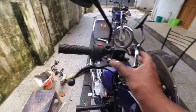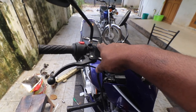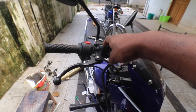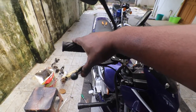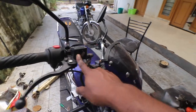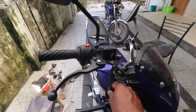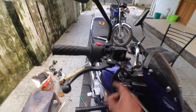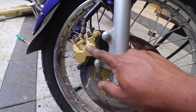This part is called the master cylinder. The job of the master cylinder is to convert this motion into hydraulic force. What you have inside is brake fluid, which also acts as a hydraulic fluid. Every time you press this, there is a pressure built up here which is transferred down through this hose — this is called the brake hose — through brake fluid. So it's hydraulic pressure which gets transferred down. So: master cylinder, brake hose.